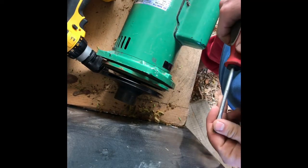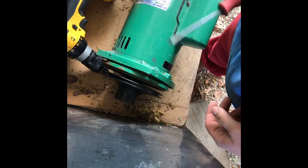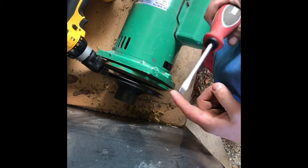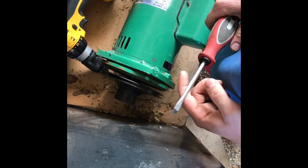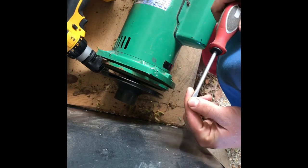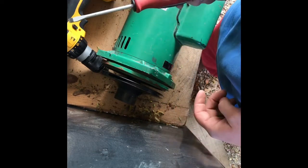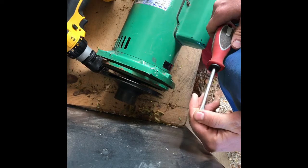I'm making a video on how to remove the impeller drive shaft on an AO Smith or Meyers two-and-a-half horsepower pump. It's actually pretty easy for the most part. What you'll need is a flathead screwdriver, an 11 millimeter wrench, and unless you had to make some modifications like I did to this pump, a quarter-inch nut driver will be your friend.